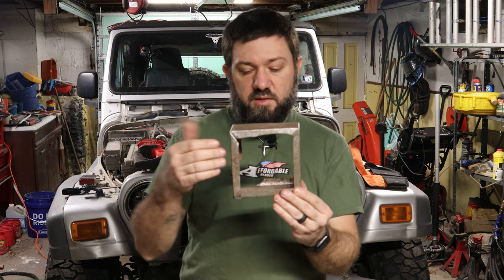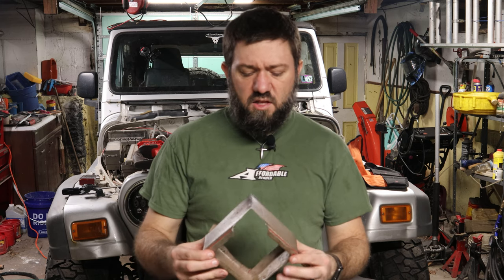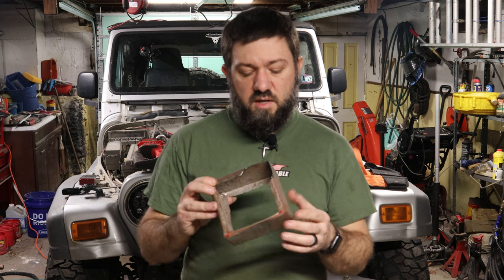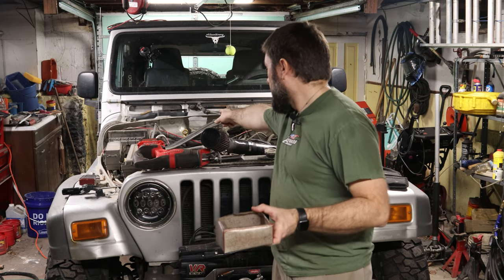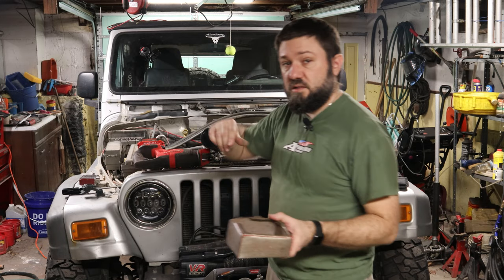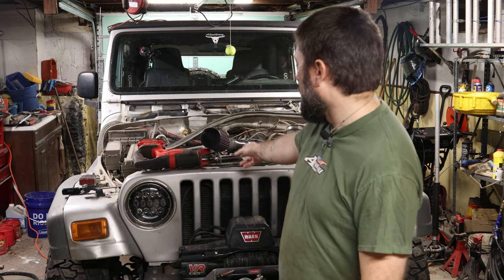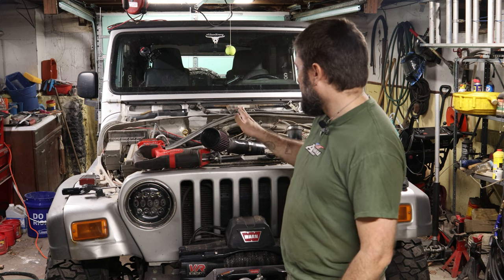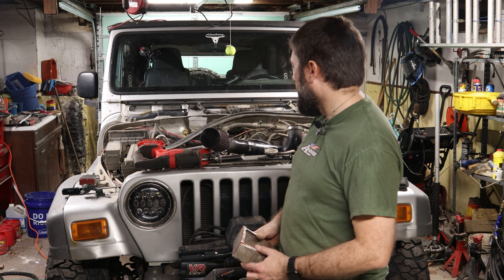So I'm going to get it in place and pop rivet it in place, which means I need to find spots to drill holes in this little lip on the back here. Now, obviously this thing looks pretty rickety. That's because I built it knowing that I was going to have to trim it to fit. There's a curve to the side there where the vent is, and so that's trimmed off. That's going to fit in there. The filter goes through it. I had to trim the firewall a little bit more to make room for this side of the filter as it goes through the firewall, but, you know, this is the trial and error we live with.